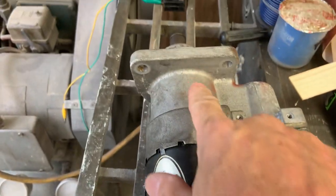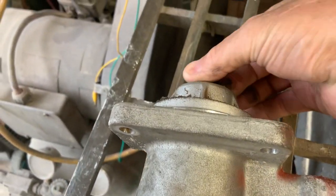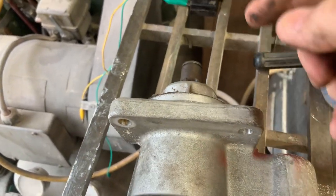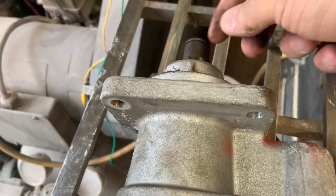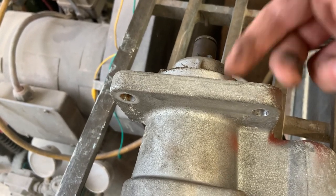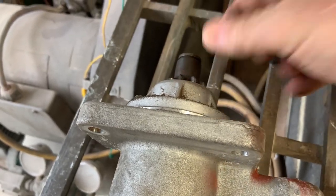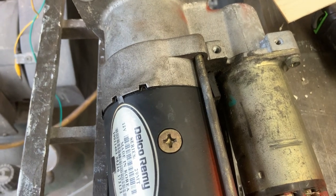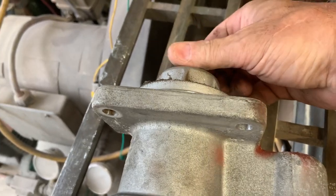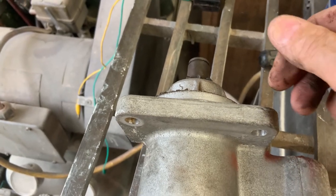This is the motor. There are gears in here and this is the Bendix — it spins freely in one direction but not the other. When this thing cranks up the engine, there's going to be a moment where the engine is spinning faster than the starter wants to go, so this acts like a clutch and lets it slip without making the motor overspeed. This force in this direction is what's cranking the engine. As soon as the engine cranks, this will slip and then you let your finger off the key.